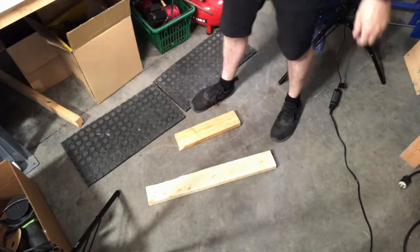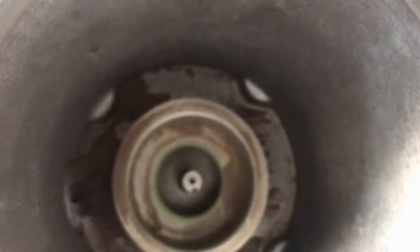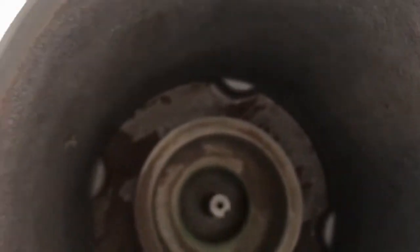The next step is to take the motor apart. Inside the unit there's essentially this casting — there's the bottom of the motor, and in through that casting is that plug you can see through the throat. It's got some Permatex Ultra Black on there. That dam is what keeps your oil from coming out. Now if you get oil going through here too fast, it can overflow the dam and go down into your motor. That's why we put a ball valve on the pump — because if you're in a hot environment, your oil viscosity goes way down and it's easier to pump more volume through, which can overload the dam.